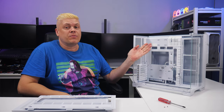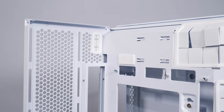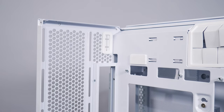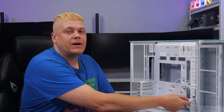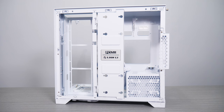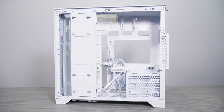Since the area above the motherboard is perfect for an IPS display, there's a new rear pass-through grommet to make it easy to run display wiring to a USB port on the rear I/O. Two long grommets run the length of the motherboard side, and there's a height-adjustable GPU support bracket that supports long GPUs and tightens with a thumb screw. The metal cable cover holds closed with two magnets and open with one, and it supports dual SSDs or provides easy access for fan or ARGB hubs.